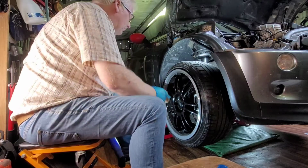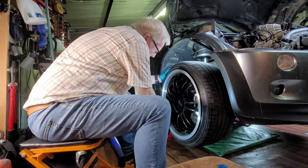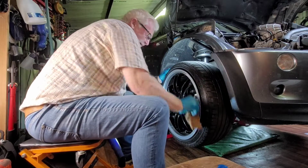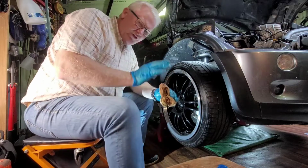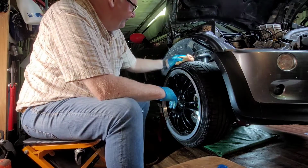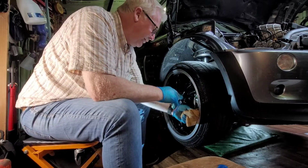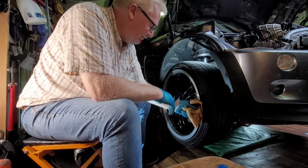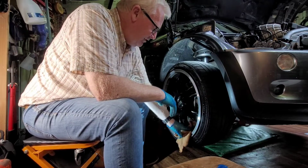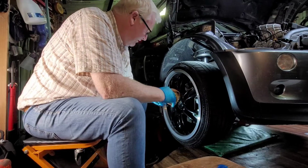I'm now going to go and do the other side. You know, never change one side without changing the other. Wasting your time, because you're going to create an imbalance, you know, and that's what fails them. If it's more than 15% difference between each side, it's a failure.